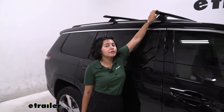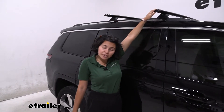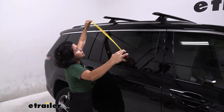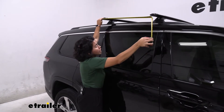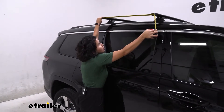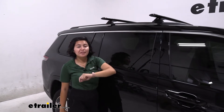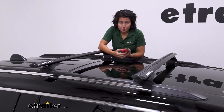This is another reason you might want a little more overhang — I'm on the short side, but this is also a larger vehicle, so this is how far you would have to reach to get your accessories up onto your roof. This system also has a fixed crossbar spread, so you measure from one crossbar to another and it's 27 and a quarter inches apart. Since it's fixed mounting points, just double-check your accessories and make sure that crossbar spread works for them.